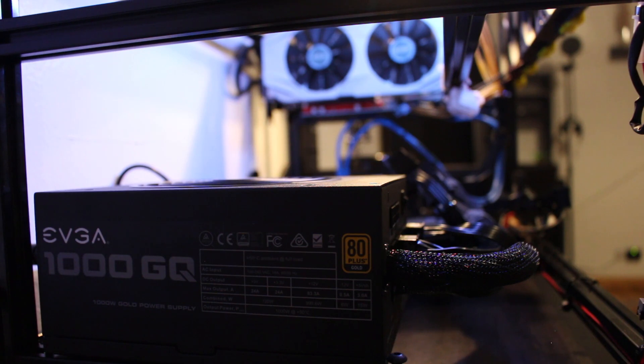The way I go about powering up my cards is by running an independent power source to my graphic card and the riser associated with it. For the second card, I would run a separate power supply, powering up only that graphic card and its associated riser.